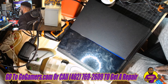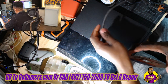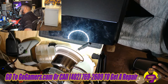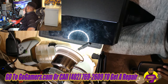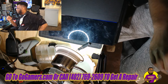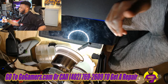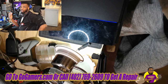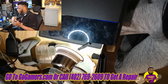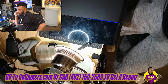We're going to power the console on right now — we have the blue light. While that's powering on I'm going to plug in the HDMI port. The best way to test out these Blu-ray drives is to use your ears, because if you actually listen to that drive — how these Blu-ray drives work is it'll spin, try to read it, and if it can't read it, it'll slightly push out the disc and pop it back in. By the way it sounds right now, it's having a hard time.